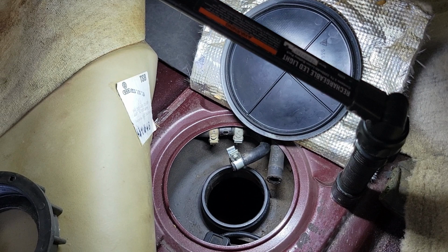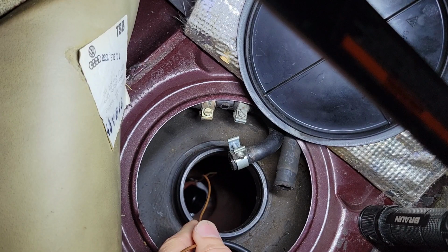However, if you simply want to see the condition of the strainer without removing it, you can see most of it by draining the tank, removing the fuel gauge sending unit, and looking down into the tank. Had I known that, I might have left mine in place and avoided this step, though I'm glad I got it done as I wanted to replace all of the filters and hoses, not knowing if they had ever been done before.